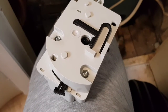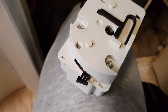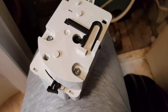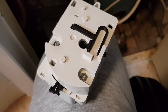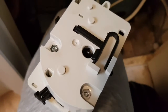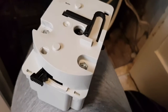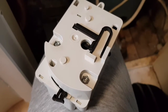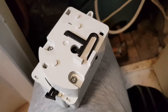With the cover back on and power restored, we can now test the unit. The hot water is currently on, so I'm going to manually switch on the central heating to see if anything happens. Pressing the button, you can see the arm on that side is swinging, which means it's controlling the valve. Changing the motor seems to have fixed the problem — switching it off and on again confirms it's responding. Fantastic, hopefully we'll have warm radiators now for winter. Thanks for watching.